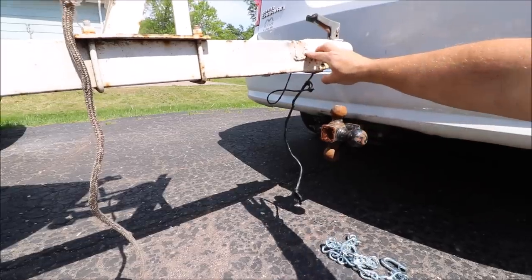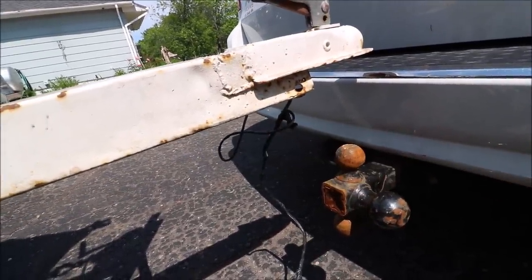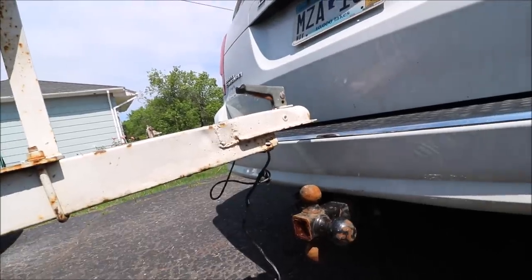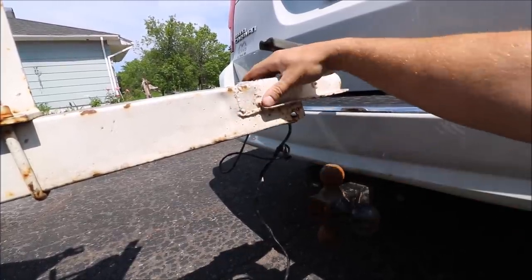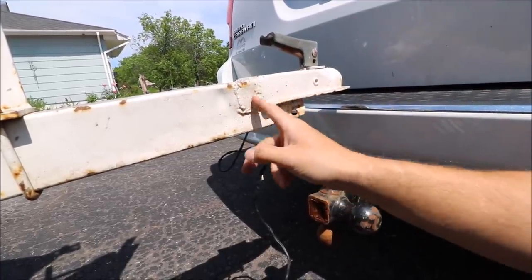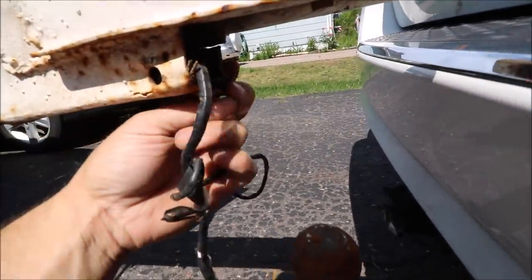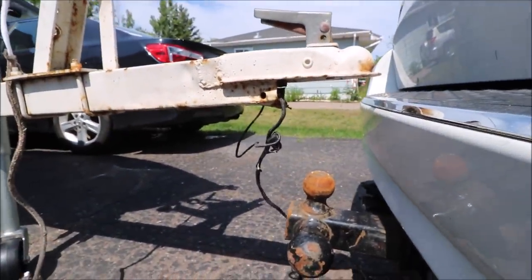Also, you can see that there has been some welding work done. So something has happened to this thing. Probably involved the safety chains and a lot, because this whole thing is kind of smooshed. So, I mean, this thing fell off at some point in time or something happened to it, but I don't like the way these welds look. I don't like how this looks either, but I'm going to drill and at least get a bolt on each side of these. I like to do that so that if the weld cracks, at least I have something that's going to be half holding on. But yeah, something has happened here, and you can really see it on this side. Something's happened, so I don't know that story, but all I know is that I can fix it and make it better.